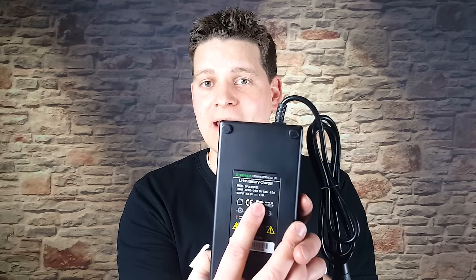Number three is the watts or amps going through the charger. People often ask how many watts or amps a charger delivers — what they really want to know is how fast will my battery charge. I prefer to look at the amps on the charger, because that's the simpler way to find the answer. For example, this one says it is a 2 amp charger. If you have a 48 volt, 10 amp hour battery charging at 2 amps, that means it's going to take 5 hours — 2 amps times 5 hours equals 10 amp hours. Some very simple math.